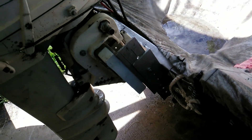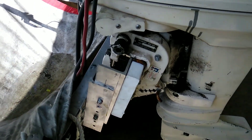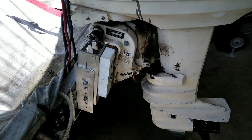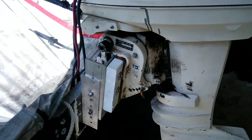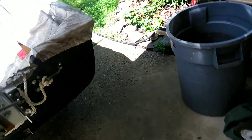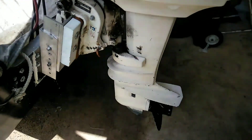At its current position it's just a little too high — it works good for top speed, but I'm going to put it down one more notch and that's pretty much where it'll stay. Top speed before I did this, with the motor just on the transom, was right around 26 mph with two other people in the boat. Mind you, this is a 40-horsepower motor with a new 13-pitch prop. With the same two people in the boat, I was actually able to get all the way up to 34 miles an hour. I wasn't staying at 34 — I was staying between 30 and 32 — but 34 was the top speed. That's about a six to eight mile-an-hour gain, which is pretty dang good.